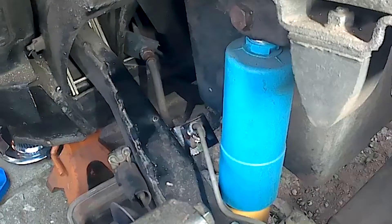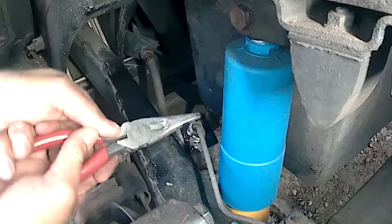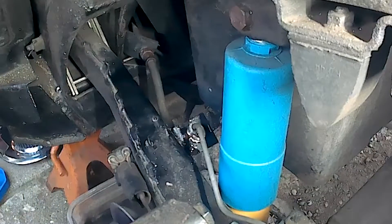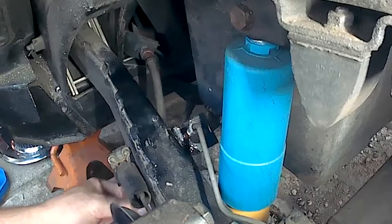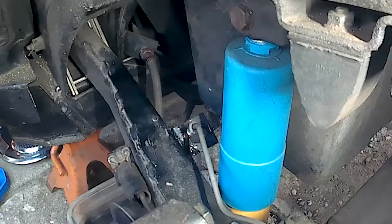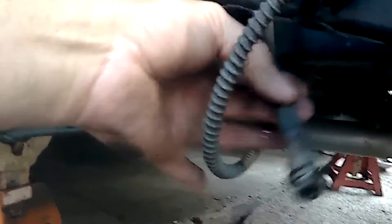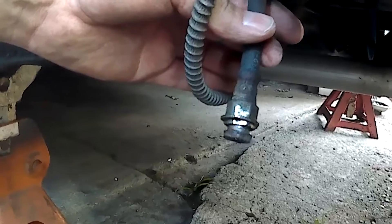Okay, that part's loose. Remove the clip that retains that end of the brake line with your favorite method — pliers, sometimes channel locks work best at this angle, needle nose will do best. Normally this would start dripping brake fluid. Bring it down here. Normally a line disconnected like that would be dripping brake fluid, but the fact that it's not indicates this might be clogged.